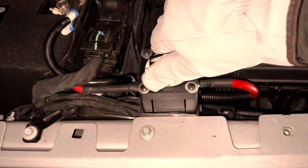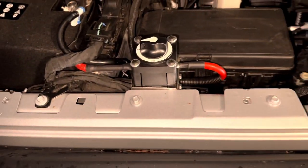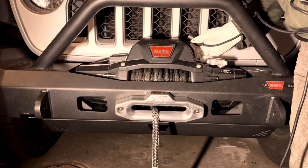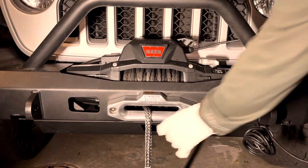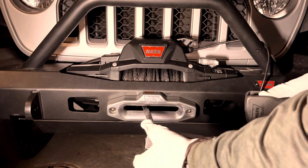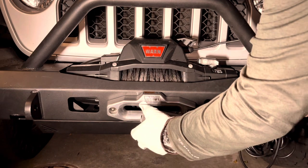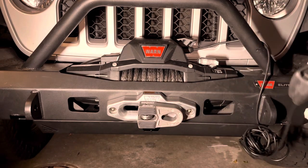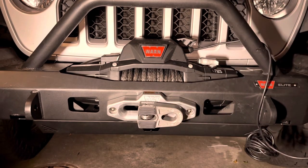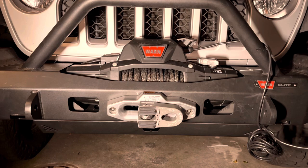Now I'll get some power to the winch by turning the disconnect to on, then I'll reel this flat link in until it's flat up against the fairlead, where it's ready whenever needed. The winch line needs stretching before you use it and there are some great videos from Warn on exactly the procedure to use to do that. Thanks for watching — I'll see you in the next one.